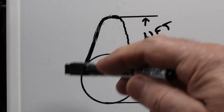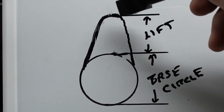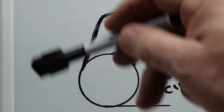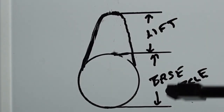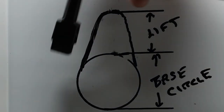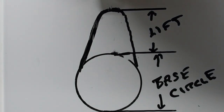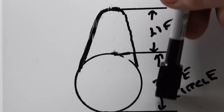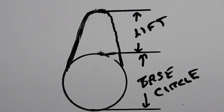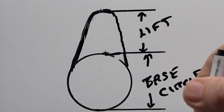This is the basics of your cam. Your cam has a base circle which the followers run all around, and then there's a high spot on your cam — this is the lift. This is how much your cam will make your push rods rise and how much they will fall as the cam rotates around. When they're on the base circle they're basically in a neutral position. As it starts to come around to the lobe, it rides up the lobe, and at the high point is when your valves are open the most, then it goes down and the valves close.